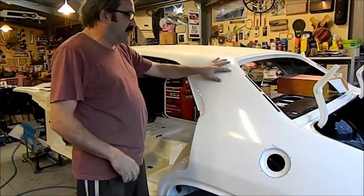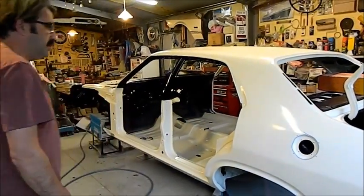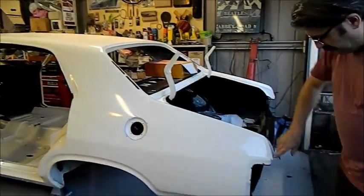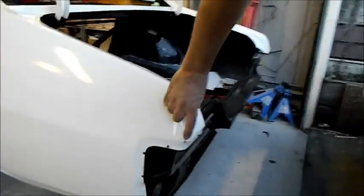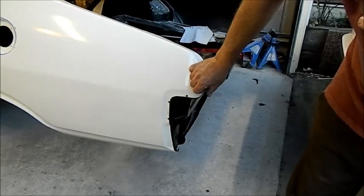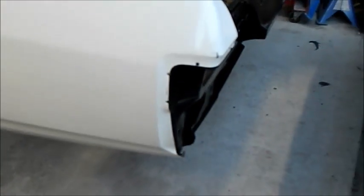Once it's colour sanded, that'll be glassy. You'll be able to see yourself in it, and that will immediately improve its appearance. Now on the back part here, there's some stuff after that. I can get some 2000 wet and rub that out. There's also a chrome strip that comes around there. I think it's chrome, I'm not sure. That looks wrong, but that's how the original was. I've got to clean that up. I thought it would have gone down parallel to that where the GTs went, but of course it's in there. That's covered up by the bumper bar, so I don't know.